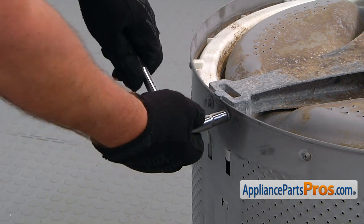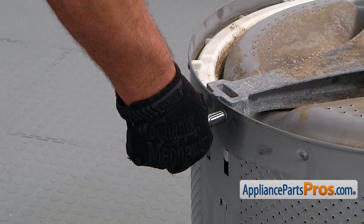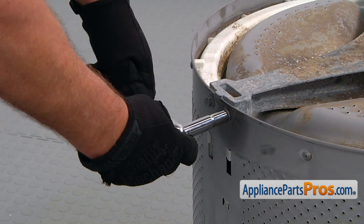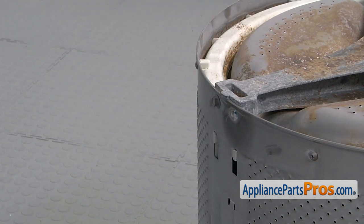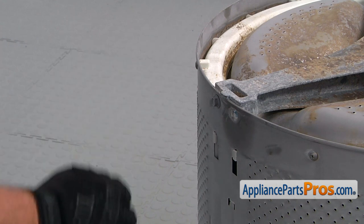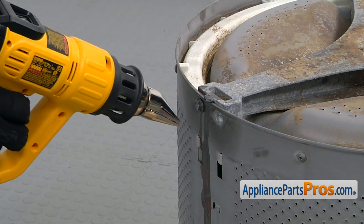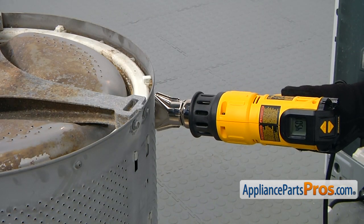Using the 10mm socket wrench, break the bolt loose — start it slowly, then return it and tighten a little bit, just a bit, before going back to unscrewing it. One bolt decided to break off — that's why it's important to order some bolts with the spider arm assembly. Spray some penetrating solution and try heating it again. For the last pair of bolts, use the same procedure.